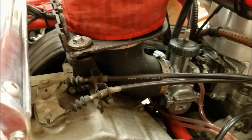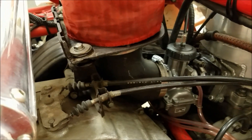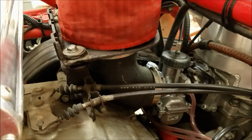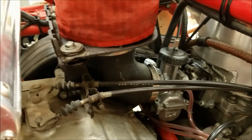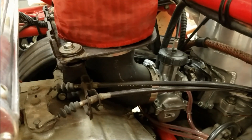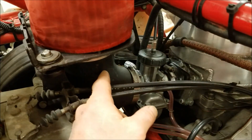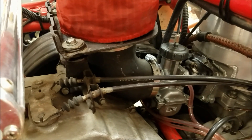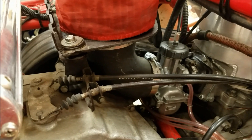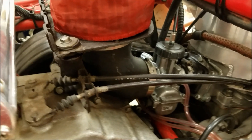I had the factory 90-degree elbow on there even with the K&N filter, and I changed it out for a three-inch rubber elbow. Not only seat-of-the-pants, but the overall performance of the buggy changed drastically — it flowed so much air during tuning that I went from 900-degree EGTs to 1100 just by changing that elbow alone. That shows the amount of airflow available. Air has mass — the factory elbow is larger at the top and smaller at the bottom, and although it can help with velocity, the mass contained within that elbow has to be moved. With a larger, more uniform elbow, you feed your engine easier.